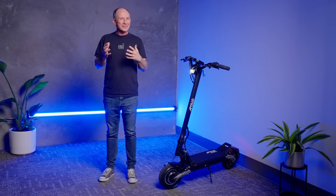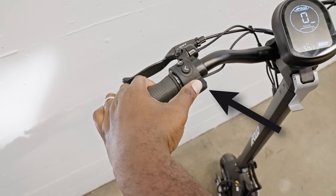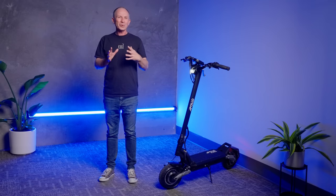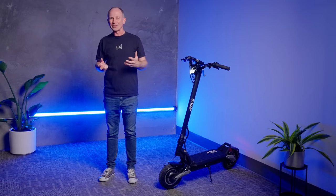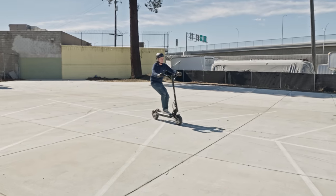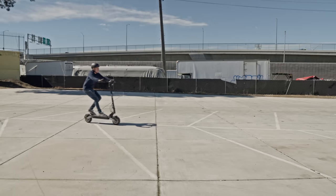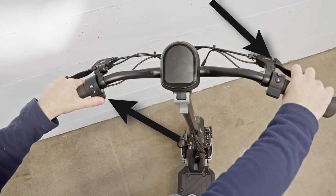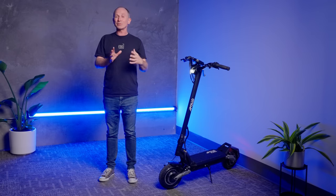But what's really different is you also get the option of not using the mechanical brakes at all, because this is a 100% regen brake lever. It's hard to even describe the feeling of this brake — it's so smooth, it feels sort of like a rubber band pulling you backwards. It's strong enough that it can stop the scooter with 100% regen brake if you want to, but will also never lock up the brakes. My favorite way to use it is to stop with only the front brake lever plus the regen brake lever, basically using it as a substitute for the rear brake.